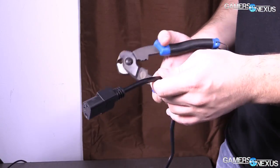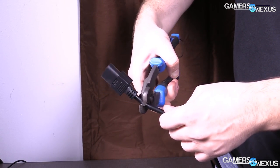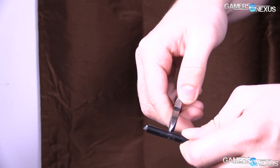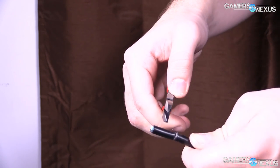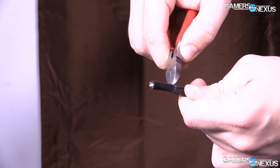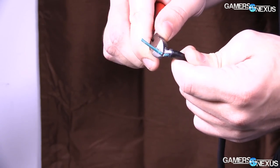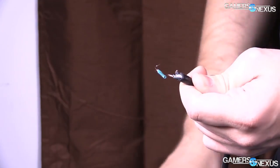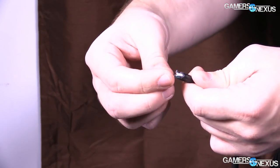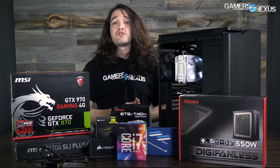The way we do it is we cut the head off of a normal power supply cable that we're not going to use. We bend the hot pins that go into the wall so they don't go into the wall — if they go in incorrectly, it's not good. Please follow our previous guide on that. You cut the cable and give direct access to the copper for the alligator clip on the anti-static wrist strap. Make sure it's connected to the ground wire and that you've safely covered any hot wires.